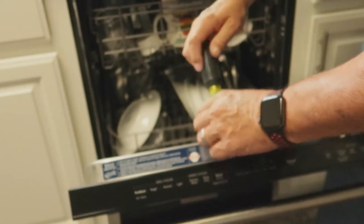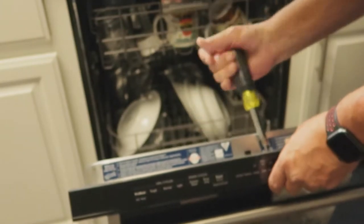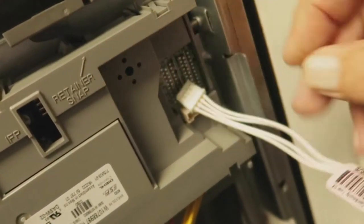So make sure you have the right tools. Klein 11-in-1 — I'll put a link in the description below so if you don't have one and want one, you'll have a source to get them. Go ahead and take out the 10 screws that surround this door. It's going to be a time-consuming little process getting these screws out and putting them back in again. Once I get the door panel off, I'm going to unplug the wire right here on the main circuit board. Push that little retainer on the bottom, unplug it, and there you go — comes right out. Set this aside so you don't scratch up your door.